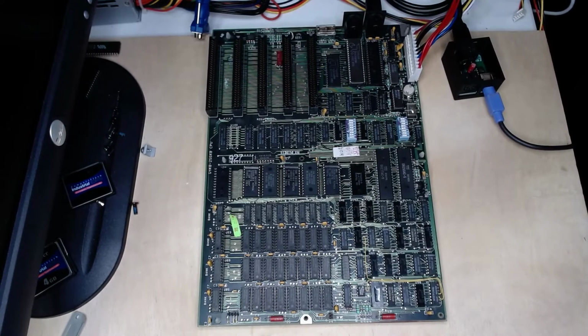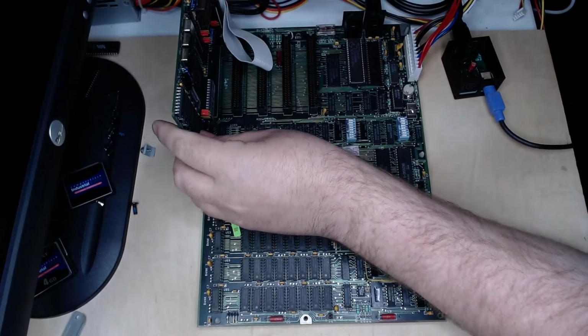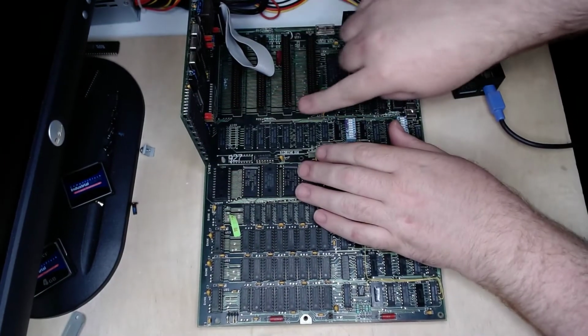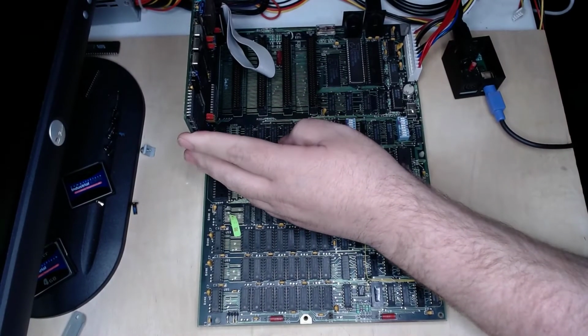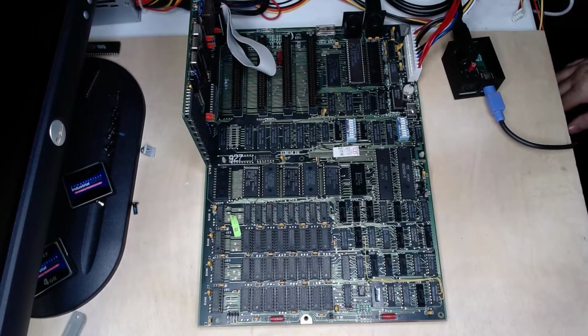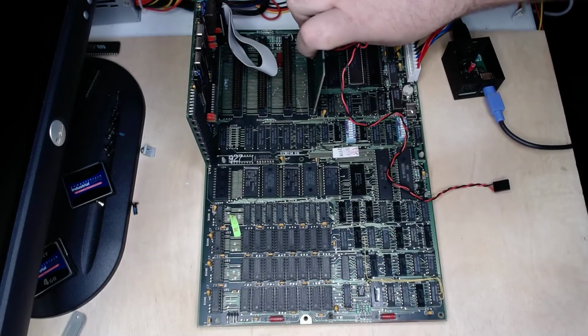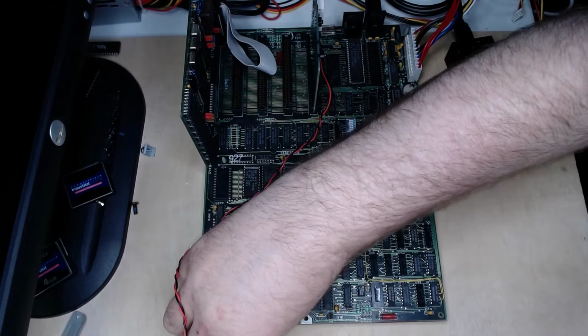Those two cards that went by the camera are 16-bit ISA cards. They won't quite work on this board. It has 8-bit ISA only, and just 5 slots too. This is an 8-bit VGA card. I'll just plug it into the monitor here, which you guys really can't see. And my post analyzer card. I think this is a speaker connection down here, so we'll connect to that.